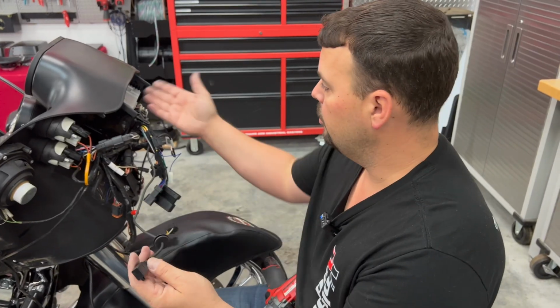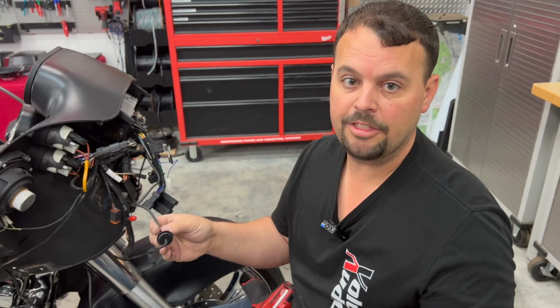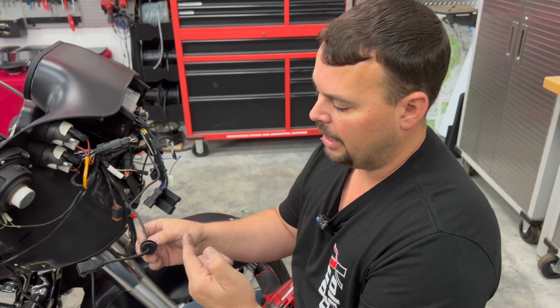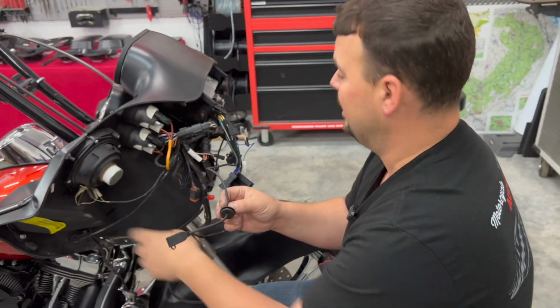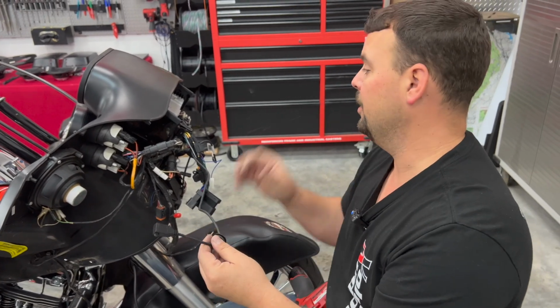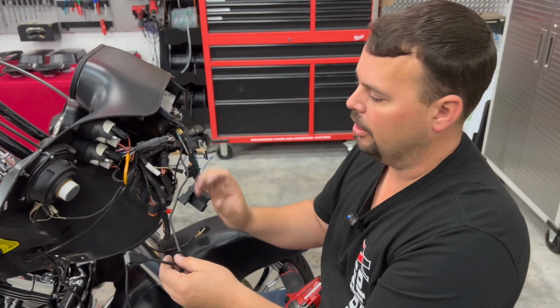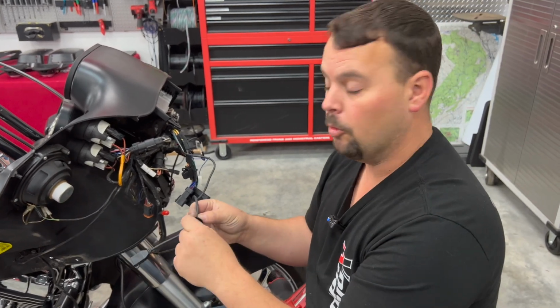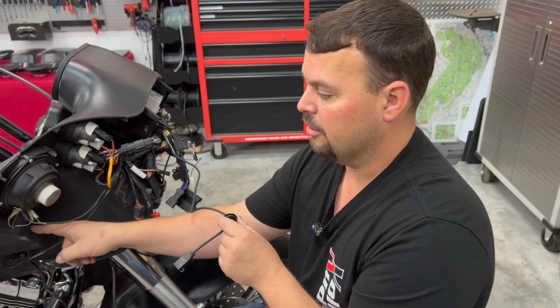All right, so included with your HDHU.9813RG is this USB. It's already wired into the back of the radio, and it has this grommet to install it in either pocket. We're going to go with this side pocket on this side, because as I said earlier, we're putting an amp on the other side. We're trying to keep all our wiring connectors over here. So we're going to drill a hole. It's roughly 1 inch into the back of this plastic pod.